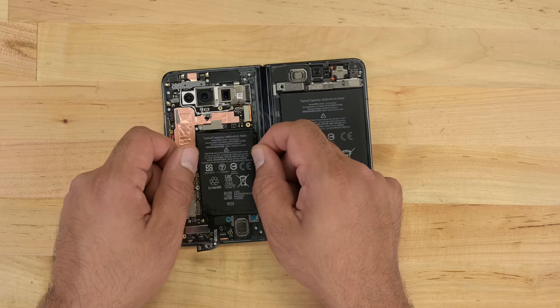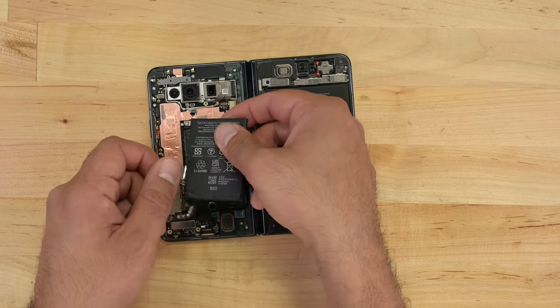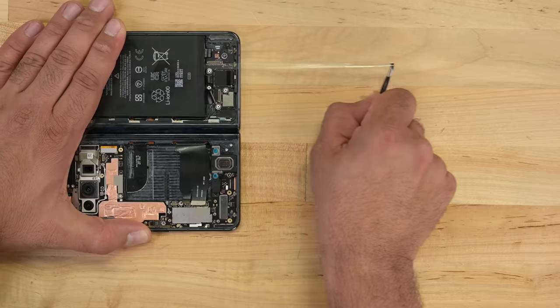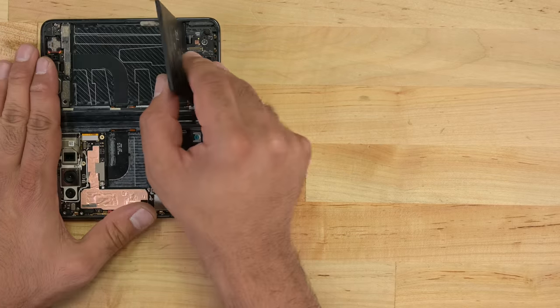Let's get the alcohol. To my surprise, the glue underneath the battery is relatively light, letting me remove the battery without struggle. The main battery sits on the more familiar stretchy pull tabs seen in the majority of Pixel phones — one, two, three, four, and five pull tabs and a bit of prying.